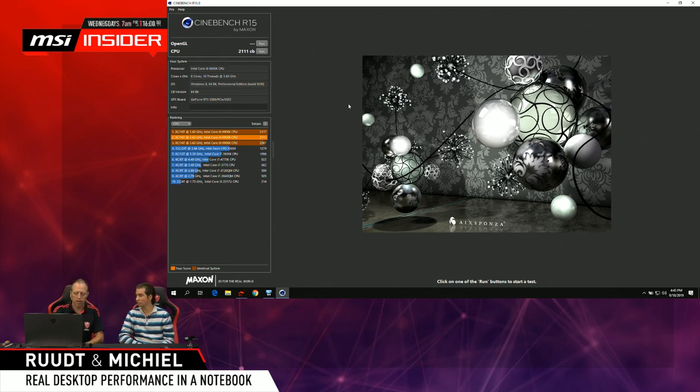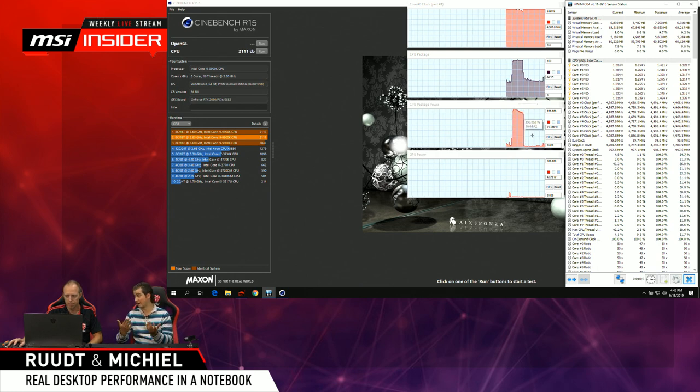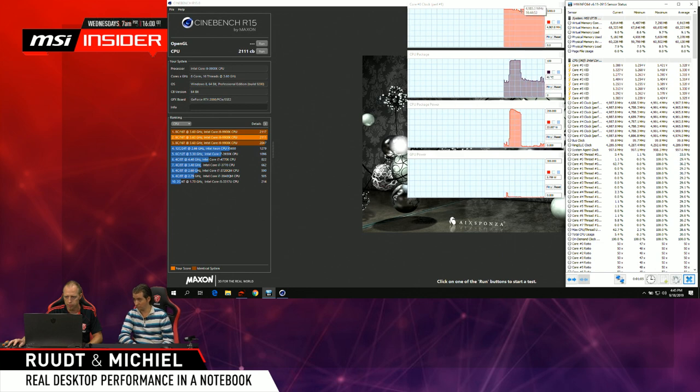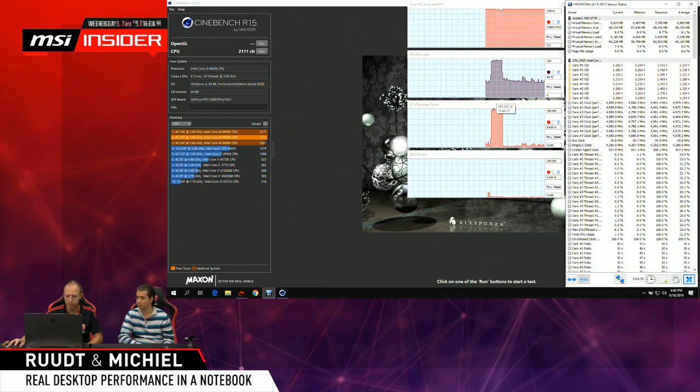And as you can see, this one already has 2100 points in Cinebench, which is quite a lot. In default mode, it will get around 2000, which is normal for an unlimited 9900K. So it's the same performance you can expect from a 9900K on a regular motherboard. You can even see that it's dropping to 4.7 in the last part of the Cinebench run, and it was about 97 degrees. So it shoots up in temperature quite fast, as the cooling cannot really adjust quick enough. That's why you can also use Cooler Boost and get maybe a percentage higher performance out of it, but it will automatically protect itself so it doesn't overheat. Even the power draw it will take from the CPU is about 207 at the maximum here. So that's really a lot.